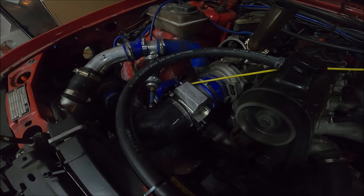Second to third and third to fourth, you change up. And unlike before, where there was a pause every time, now there's not. So yes, it works. Another good thing is I didn't see any smoke at the exhaust. And obviously, being a side exit, I can just see it in my rear view mirror. If you were going to see it, you would see it after letting off at full boost, and you'd see a lot of smoke. I didn't see any. So that's promising.